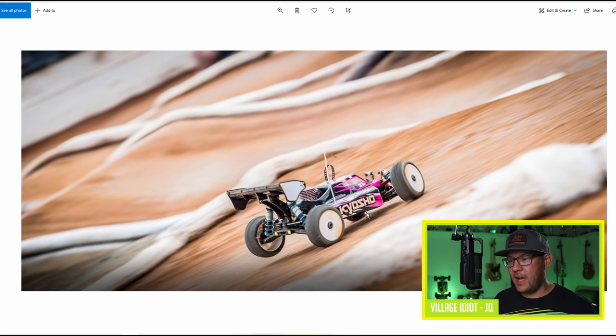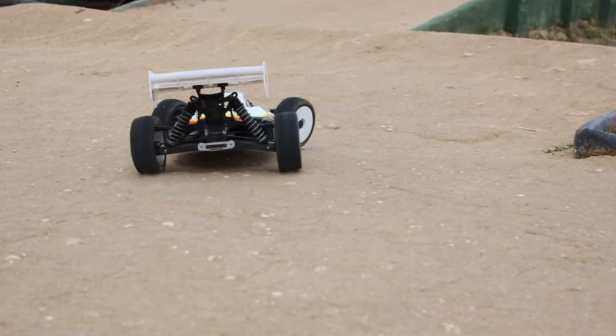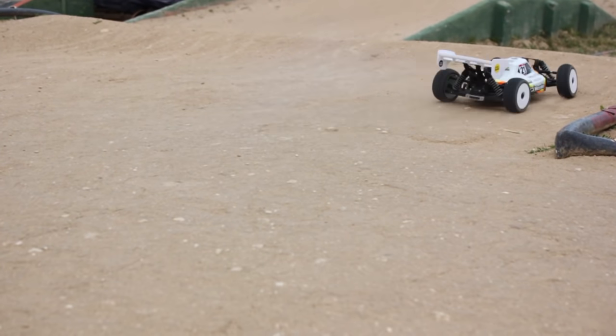Now, this can happen even when you aren't braking. In this picture, I don't know if the driver is also braking, but you don't need to. All you need to do with a high roll center is really to turn into a corner, and you will see that the rear end lifts up. We actually have video of this. First, you'll see a car go around the corner with a high roll center. As you can see, the rear end is high up off the ground. The jacking effect is in full force. Now, a car with a low roll center.